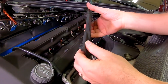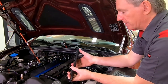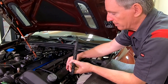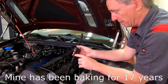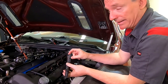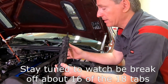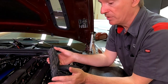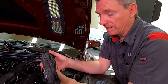This cover unfortunately is made from some sort of plastic composite, and this area is insanely hot — we're right above the exhaust manifolds and right up against the cylinder head, so there's a ton of heat soak in here. After a number of years, this plastic has become highly brittle. It's held together with plastic tabs that you have to bend up to remove it, so it's almost a guaranteed certainty that you're going to break this plastic cover when you remove it. You should probably already have ordered replacements before attempting this task.